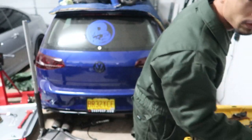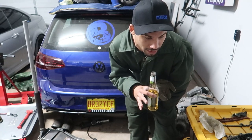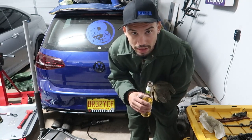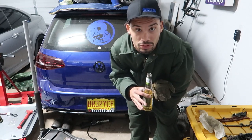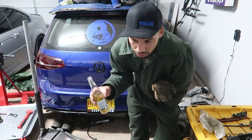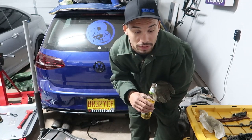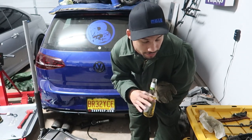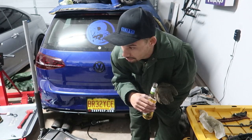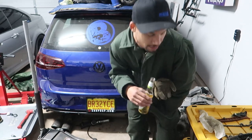This is hopefully the last episode on the teardown part of the series. We're going to get the crank out, look at the bearings and thrust washers - about eight bolts or so. The motor's going up to the machine shop to get bored out with half a mil bigger pistons, then we'll have them measure clearances on the crank and bearings for the rods. I'm super excited - just need to get this crank out, load the stuff in boxes, and hopefully be on my way tomorrow morning.